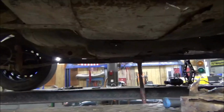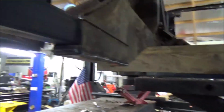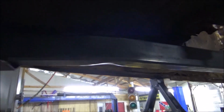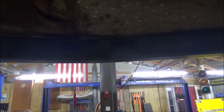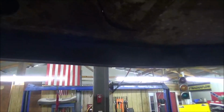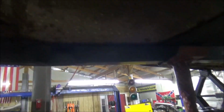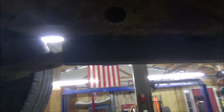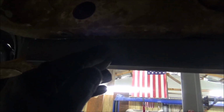All right, guys. Let me show you where we're at now. We're doing basically the frame connectors. As you can see, it's some 2x2 square tubing. We go 8.5 inches up into that front. And you see we bent it over 20 degrees, and then bent it up for what, like 2 degrees? Yeah, something like that, in order for it to conform up to here when it's pushed up. The floorboard's got it pushed down a little bit. We'll show you how we do these bends using our tubing bender on this other side when we get there. But for now, we're going to get this side finished first. And what we need to do here, we're going to come here and cut us a 45 and plate it in where it looks nice and trash can't get up in it. We'll clean up all of this so we can get a good weld to it.